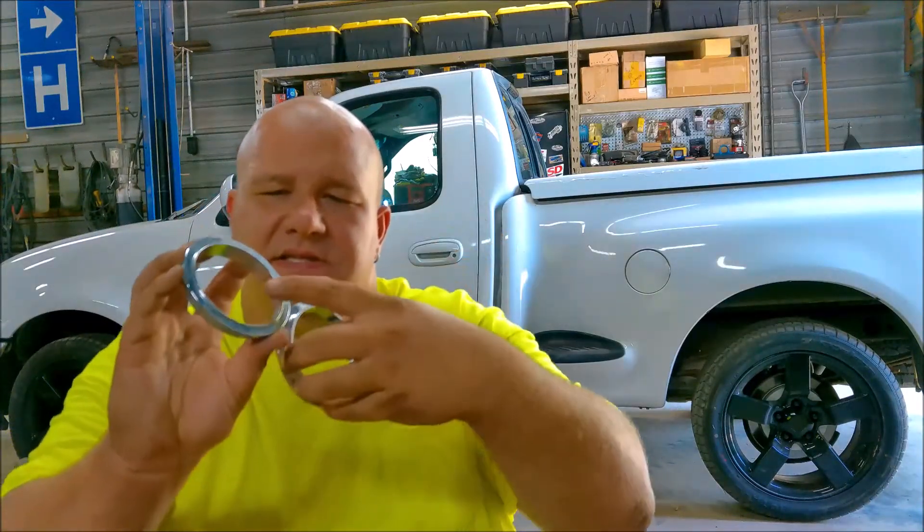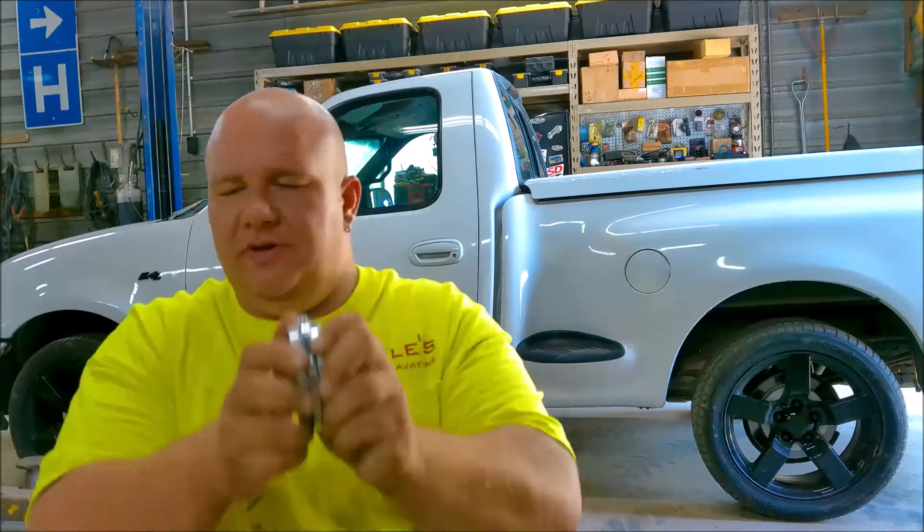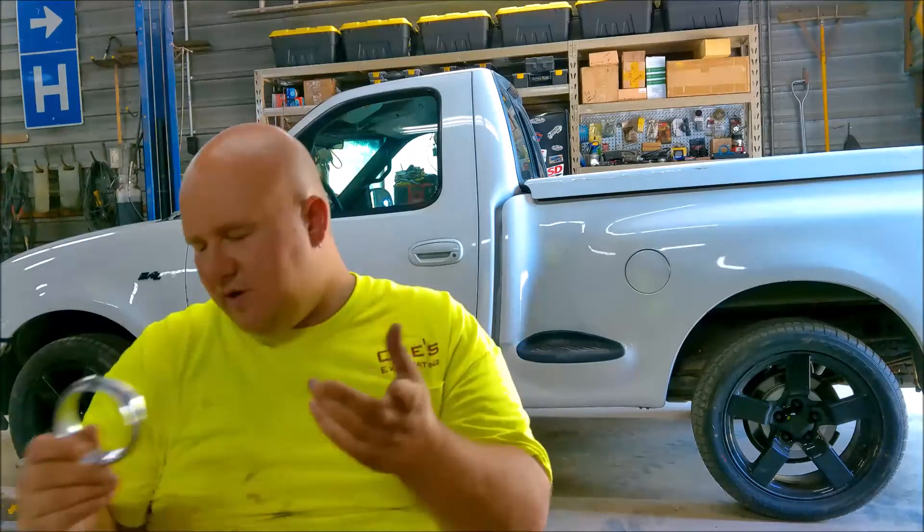I love the way it looks - hopefully it'll make a really good seal. The V-band clamp has actually got a little step in it - it locks together, so you can't slide it. Then you just have a stainless V-band clamp that goes over it. I have that where the header meets the Y-pipe, and where the Y-pipe meets the flex fitting to the muffler. It's 3-inch out of the collector on the header, the Y-pipe is a full mandrel bend 3-inch, then it goes into a flex piece, into a 3-inch Thrush muffler, turn out the side.